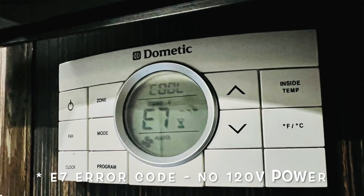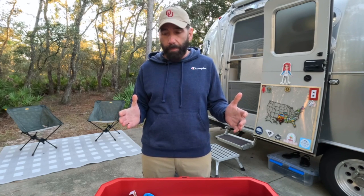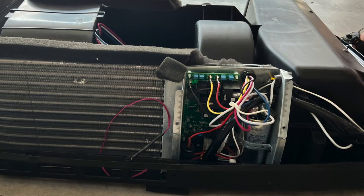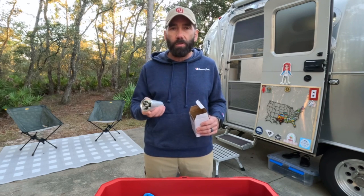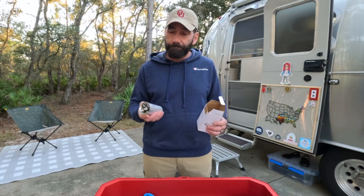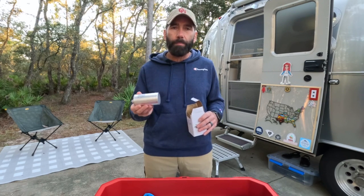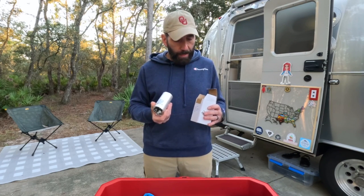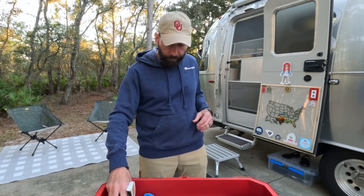This past July, my air conditioner broke down while we were on our way up to Maine to attend the international rally. I tried calling around trying to find this part. Unfortunately, I did not have a spare at that time. I was able to acquire a part when I went to a national RV chain — they just happened to have an old Dometic air conditioner sitting out back that they had just replaced off of somebody else's camper. I asked them if I could look at it to see if it had the part I needed, and sure enough, it was the exact part. So I was able to salvage that capacitor off of their air conditioner and get my AC up and running. Ever since then, as soon as these came in stock, I went ahead and ordered one. I keep one on hand now for those emergency situations, because this is probably one of the most common parts on your air conditioner that's going to go bad.